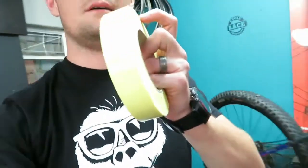When using something like a Stans wheel, I'd advise you to use this yellow tape. But I'm not going to use it in this case because the yellow tape is more like a plastic texture — it's quite a hard tape. The one I'm going to use is the Gorilla Tape, which I think is quite a good tape. You can use this on every rim. On a Stans wheel with a shallow rim on the inside, you can use that plastic one.